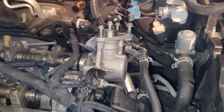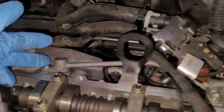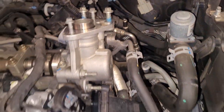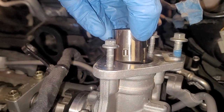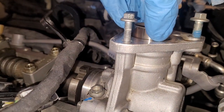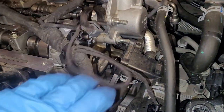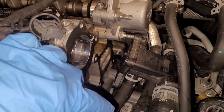And then at this time, I decided to go ahead and put the coolant line that bolts in back here because that goes on one of the studded bolts, and then you put a nut on there. And now is a good time. There's a cam follower. It's got a little key here towards the front. Should be able to feel how that goes and push that in. All right, let's get the water outlet manifold down here.